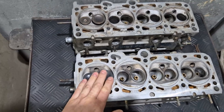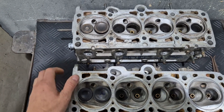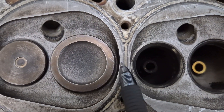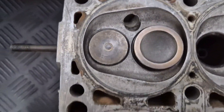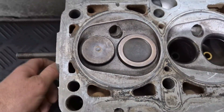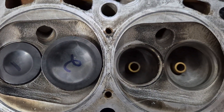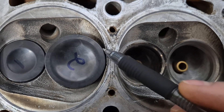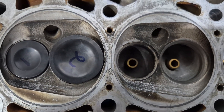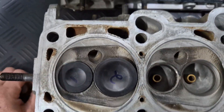If you want to go bigger valves, you need to know what you're doing. You can't just go bigger valves because it's better and there's more airflow — you have to make it work for you. Look at the standard valve. Look at the space for the air to flow — it's the same on the exhaust side. Now come over to this valve with the big valve. The guys literally just destroyed the airflow in this area by going bigger valve. The big valve is supposed to help you with more airflow but you just went backwards. So you're kind of defeating the object with a big valve.